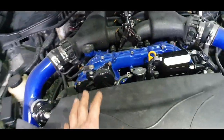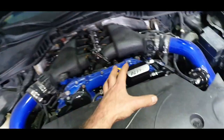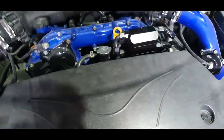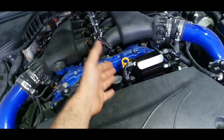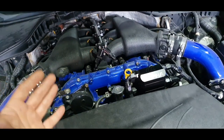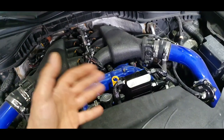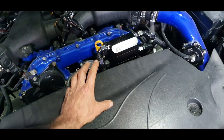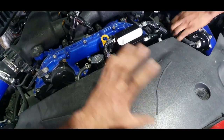This one is not something standard. This is not something plug and play or stock. The clutch is custom. The pedal, the master cylinder, the slave, the clutch set, everything is custom. So you're not going to do it with a plug and play solution. If you get something ready, flywheel, clutch, pressure plate, they give it to you ready. It's already adjusted.